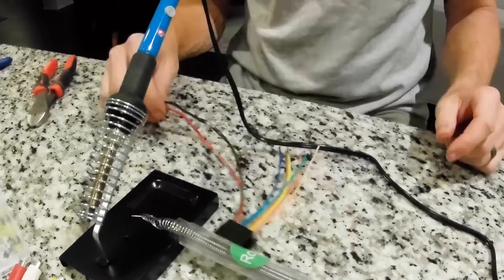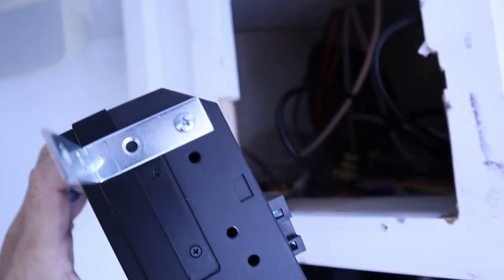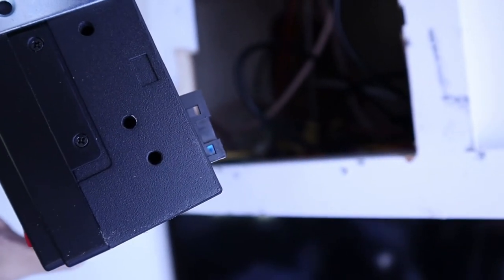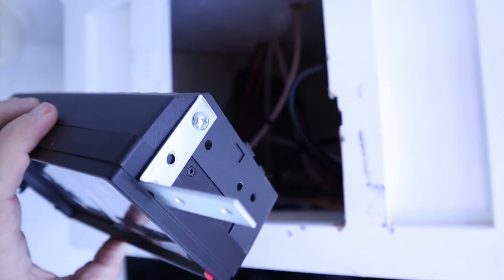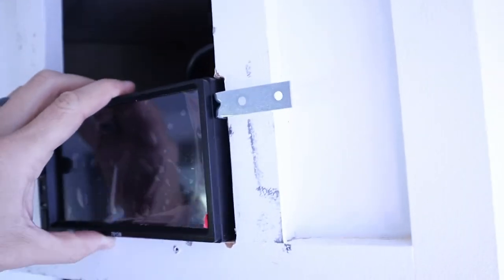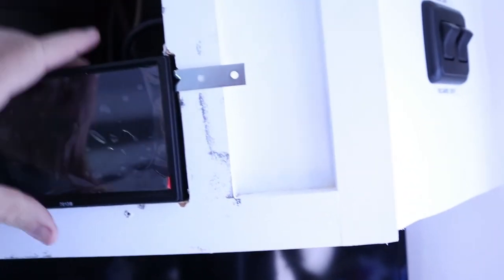And that's it — let's go connect it and see if it works. Before we make the connections and test it, I want to show you how I ended up mounting the stereo and covering it. I couldn't find a good match for a car kit, so I had to improvise. I ended up using two 90-degree L brackets and mounting them to the top hole on the side. All these holes are threaded, so I just had to find the right screw. I also had to make a little more space for the unit to fit — cutting out a small section on each side so the stereo would slide right in. I also had to add a small 3/4-inch thick piece of wood as the bottom support to prevent any kind of tilt.